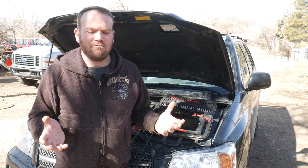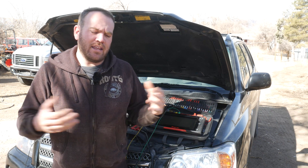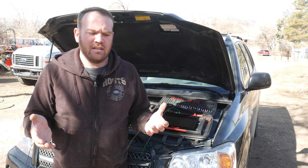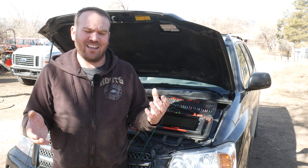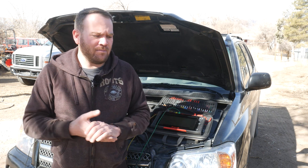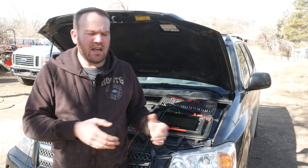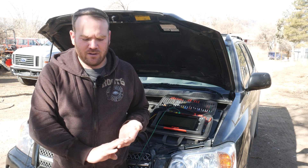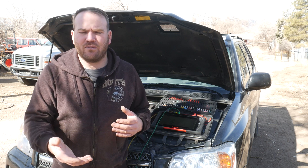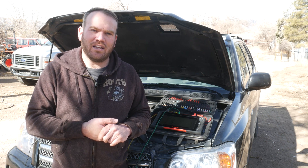This is a fairly simple test. There's not a whole lot of known good references for mass airflow sensors out there — it's not something that most people test; they typically go to the scanner data. But what happens when you're not getting a signal that you expected? Most people are going to take the mass airflow out, look at it, see if it's clean. If it is clean, they're going to replace it. If it's not, they're going to clean it and try it again. But if that doesn't fix it, then they're going to be kind of stumped. So if you do a couple of basic checks — make sure you have power, make sure you have ground, make sure you have a signal coming out of it — it might save you from throwing parts at a vehicle. If you have any questions or comments, put those down below. Thanks for watching and I'll see you next time.